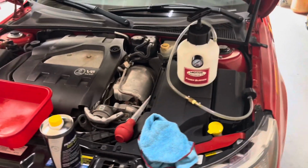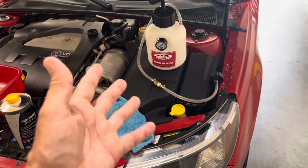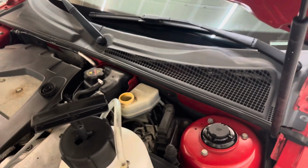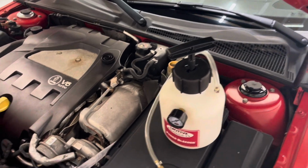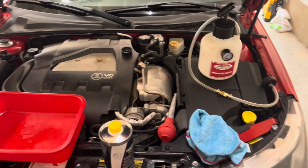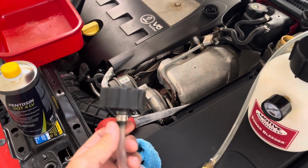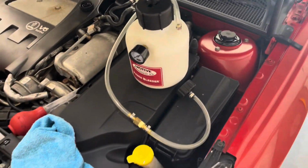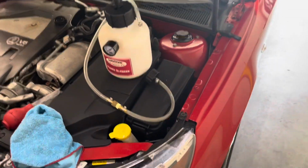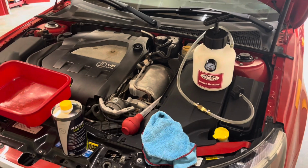This is a backup measure. Before you get going with pumping the brakes and not pumping the brakes, this kit here, in 2024, might be 60, 70 bucks. That might be 10 bucks. And then you get out of the pump and brake business, because that's a coordinated effort, requires people's time, and you can just, for under 100 bucks, never ever have to deal with it again. Anyway, one thing unique about this kit is you have to buy adapters based on the type of car you have. This one here is the European adapter. I'll put a link to it in the description below. You can buy them with Chevrolet or GM adapters, Ford adapters, Volkswagen, whatever. Well, now, Volkswagen would be considered European. Anyway, make sure you have the right adapter before you start the job. Otherwise, it's not going to work right.